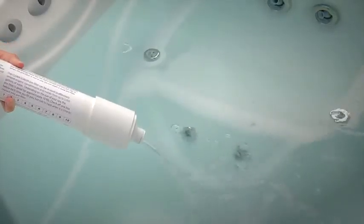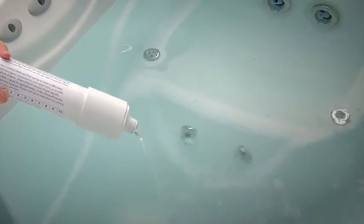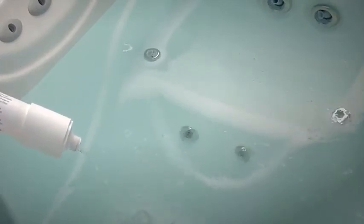Now that the hot tub is full, turn off the water source and then turn your flow valve to the off position. Disconnect the clean screen with the flow valve intact, allow your water to drain out, then screw on the red end caps. You can now store it for future use.